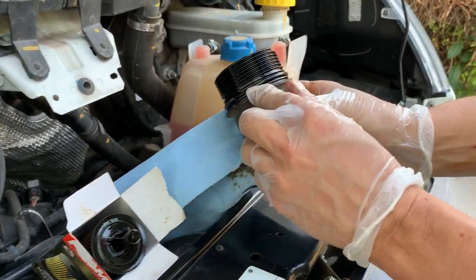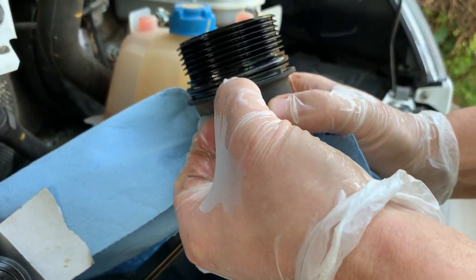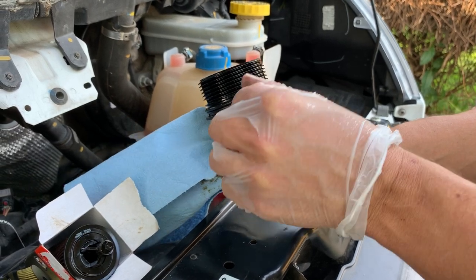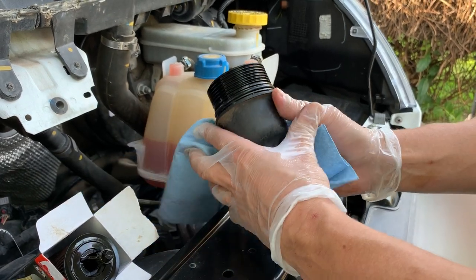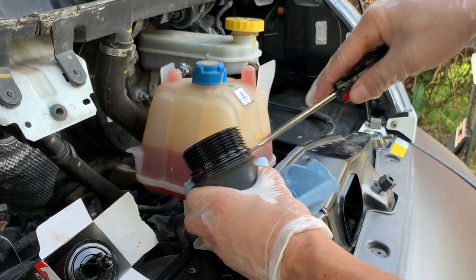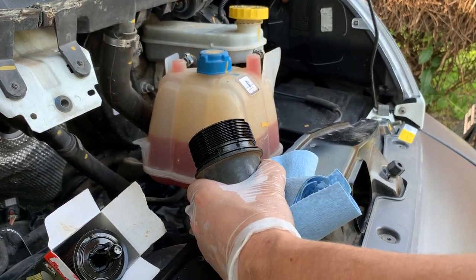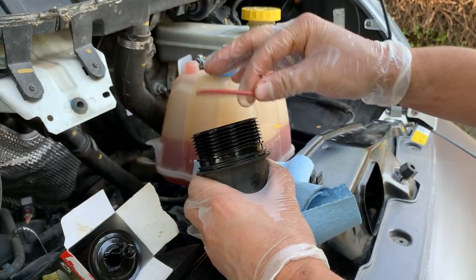If you look at the cap, there's an O-ring — a little rubber O-ring that goes all the way around. We're going to remove this and put the brand new one that came with the filter on. If you leave these on they can get brittle and actually break and then you won't have a seal, so it's an absolute must that you replace that. I'm just going to grab a screwdriver and work it off — this will take a few minutes, need to be semi-patient to get it off. Then we'll put the brand new one back on — you can see it's a whole different color.